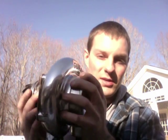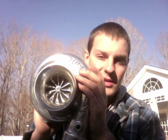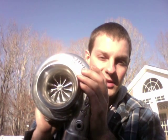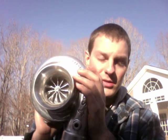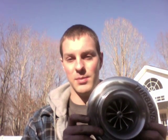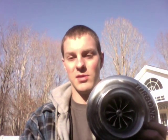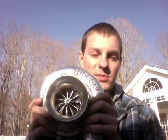As far as what you can make horsepower-wise with this thing, you can make about 700 horsepower if you have the right exhaust housing. You can go to a .82 T3 or a T3 1.06. If you go with the 1.06, you're pushing it close to 700 horsepower capability.